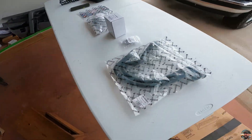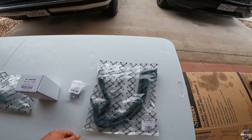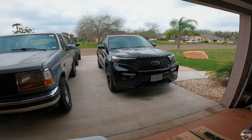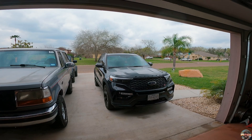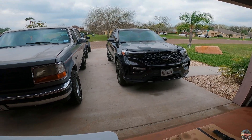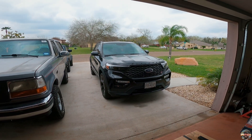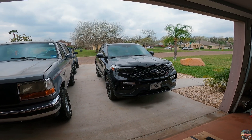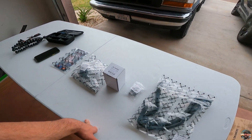I will go over why you would need to add this, or possibly add it, to this vehicle. These EcoBoosts are great engines — they're direct injection — but they can have a little bit of blow-by that could potentially foul the oil and just rob some power. So this catch can eliminates that. Let's get after the install.